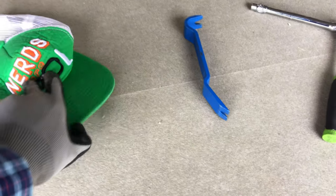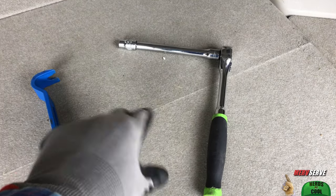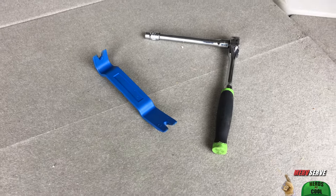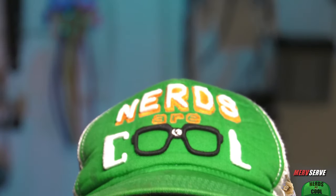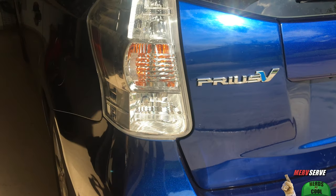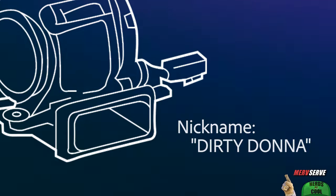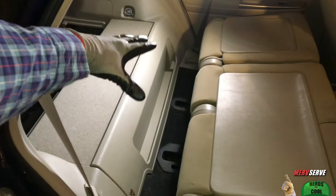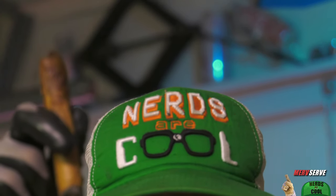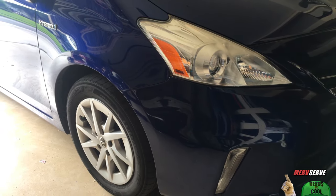We're in the back of DeMille's third generation Prius and I'm about to teach him a heck of a lesson. Basic tools: a 10 millimeter socket with extender, a nice plastic pry tool, and later a shop vac, a bottle brush, and maybe some Cuervo Gold. DeMille left his Prius V here while he's out delivering fertilizer. He's been worried about the hybrid warning lights on his dash but too chicken to try the simple fix of cleaning out the hybrid fan. He insists it's an all-day job, but I know darn well it ain't — not with this version of the Prius. So I bet him my fully loaded Tacoma against his Prius that I could get it done before he gets back. Here we go — I'm gonna peel open this glorified toaster.